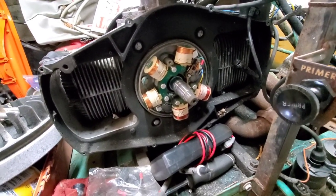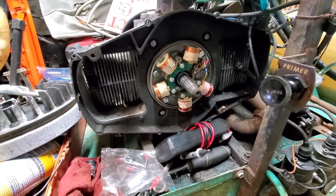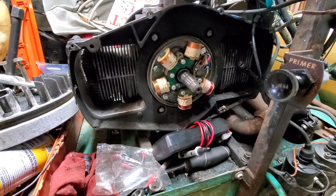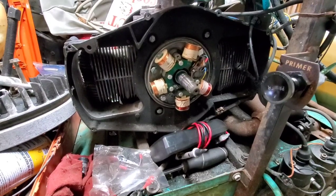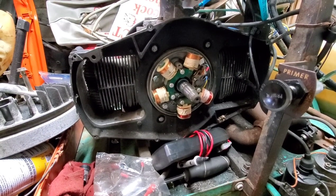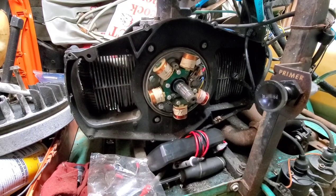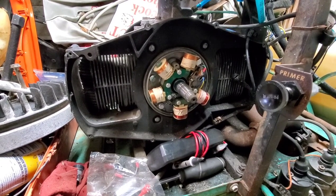I think what was happening is there was enough spark to hit the stroke. Excuse me. There was enough spark to spark when the plugs were out, but there wasn't enough spark to push through the compression. That's my thought anyways. Except for when we threw the carburetor cleaner in, there it would generate just enough to burp, to backfire like that. Just enough. Barely enough.